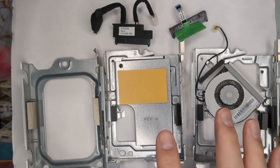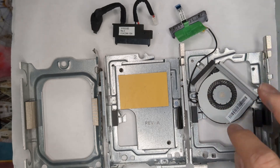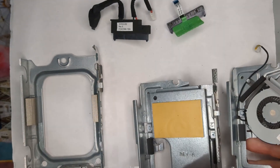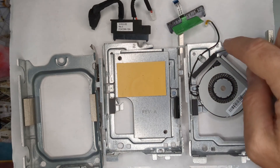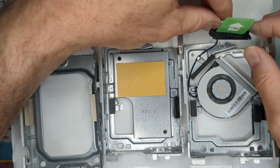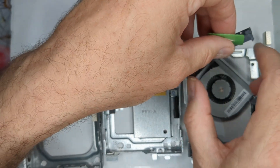These two are what you'd get on the G2 — this one for the 35-watt and this for the 65-watt. The 65-watt comes with an additional fan. The bottoms are the same except they've taken out a metal piece to make room for the fan. These also have three screws — even labeled one, two, and three. They have a SATA connector that doesn't screw in; it just goes into a little slot and sits there with a little pull tab to help disconnect your SATA drive.